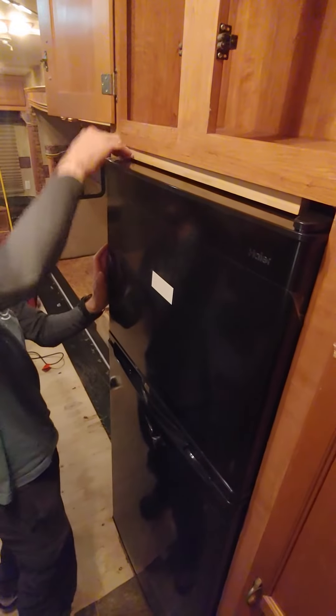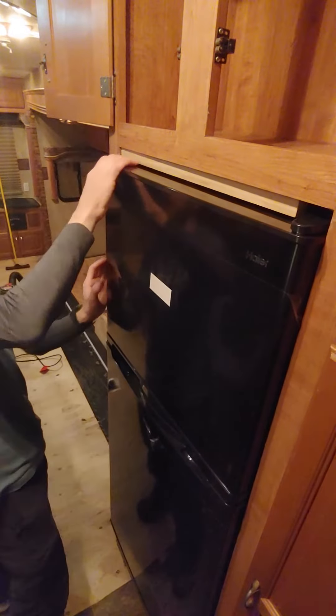This is a piece of hardwood on the inside and this here is a piece of hardwood. I screwed that there and it's actually putting a lot of pressure on the top of the fridge on the backside, so it holds the fridge in place. On the backside in the frame of the fridge there's a piece of reinforced aluminum for the bottom of the structure, and I screwed through that into the plywood on the back. So the back is screwed and the top is secured — going down the road this thing's not going to move. Perfect.